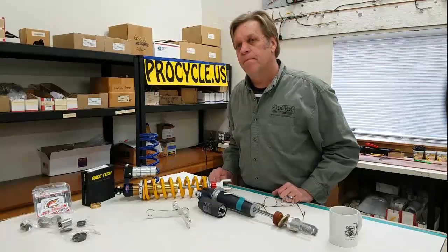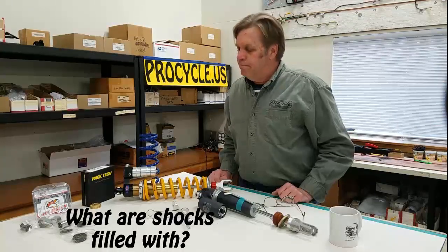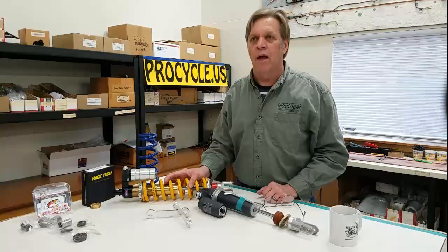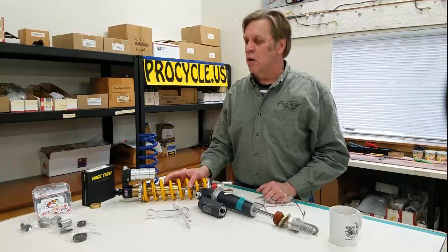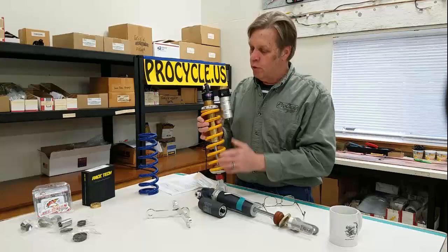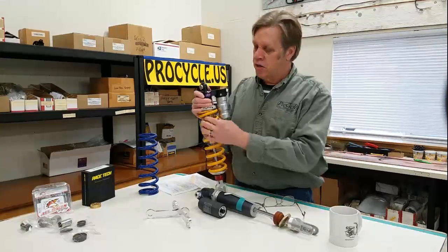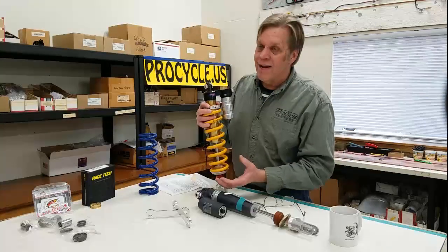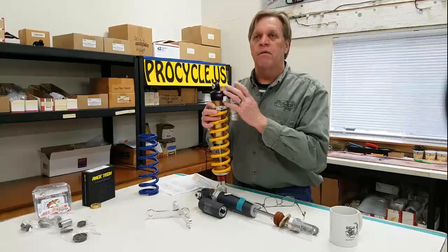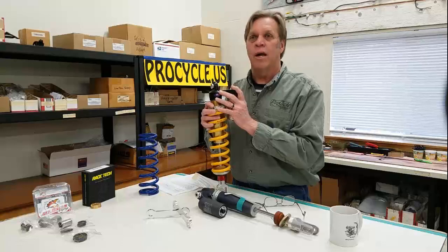As far as rear shocks go — similar to automotive — are there hydraulic or nitrogen-charged shocks, different types, and what are the benefits? Most street bikes and dual sport bikes, unless you're talking about big BMWs, don't have completely gas shocks. Most shocks are going to be fluid — they'll have fluid inside the chambers. If they have a reservoir, there'll be nitrogen gas inside the reservoir. The fluid moves up and down through the valving, compressing the gas inside the cartridge, and the valving determines how well it dampens on compression and rebounds. But about 99% of all shocks are going to be all-fluid or a fluid-and-gas mix. It's very rare to have a completely nitrogen-only shock like an automotive.